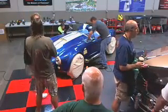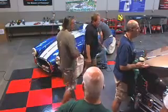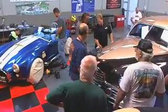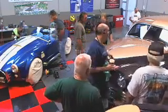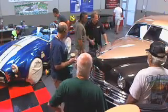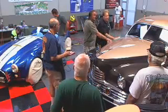What about a single stage paint, without any clear coat? Well, single stage paints are usually very easy to work on because they're soft, unless they're single stage white. This one has a little bit of mottling, but that's under the clear from the painter. What we did was pull all the swirls out of the top coat, so now it's really clear. We are ready for wax.